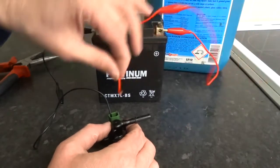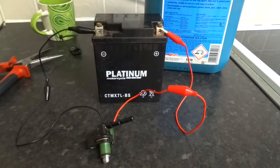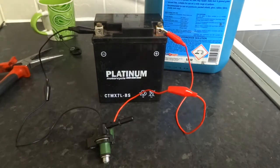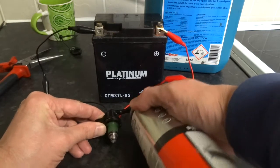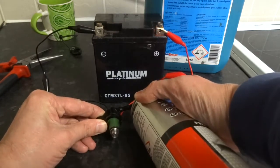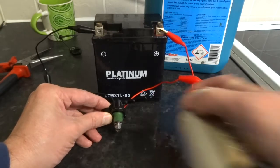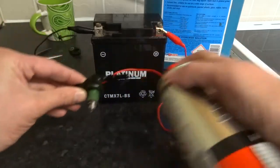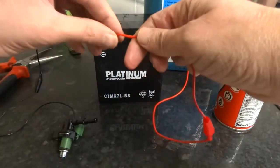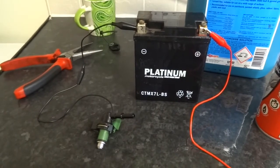I'm going to put the wires in and open up the injector again. You want to check the spray pattern as well when you're doing it — it should be in a nice pyramid or triangle torch shape. I'm pretty happy with that spray. I'll try it again. Now it shows itself. Hopefully you caught that on camera. I'll set it up and try and do it again for one more last shot.